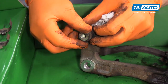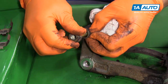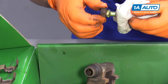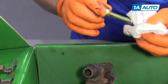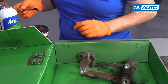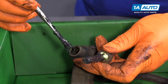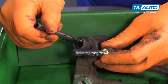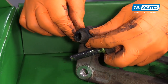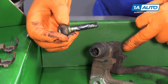Now I'm going to take the caliper slider boot out. Just basically pinch down on the rubber slide boot and pull the slider out. That's old manufacturer grease so I'm going to clean that off. You always want to apply brake caliper grease — a nice thin coat to the slider. I like to put caliper grease on the inside of the boot as well; that keeps it flexible and I also get to check for any holes. You don't want any pinholes or rips on these boots because then water will get into the pin and seize it up from sliding.